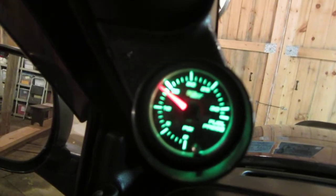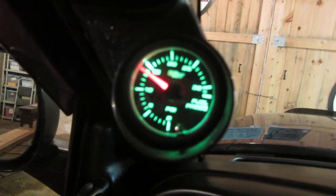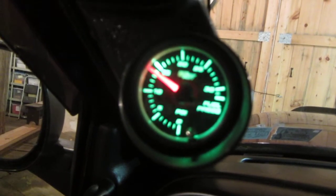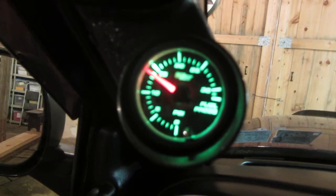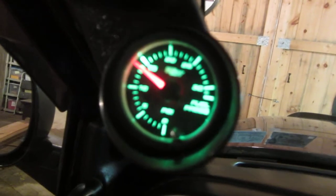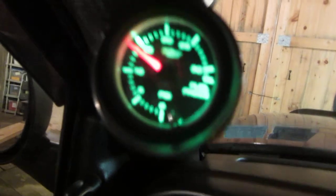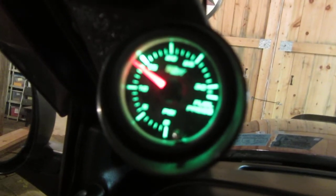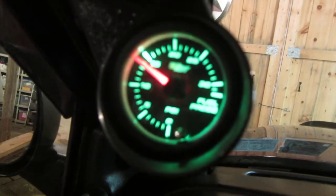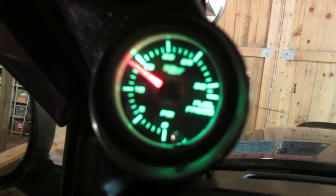It can really warn you if one of your fuel pumps is going bad, whether it's your lift pump or your main pump. If it tells you your lift pump's bad and you replace it, it could save you money in the long run so it doesn't wreck your big pump. On this truck, for example, which is a 2000 Cummins, the Bosch fuel pump — the main one in the front — is extremely expensive. It's like $1,500 to $2,000, which a lot of people don't really have laying around.